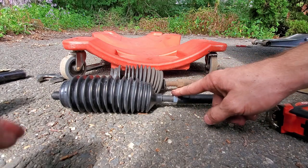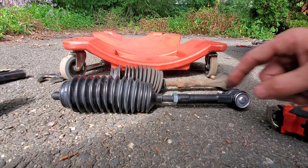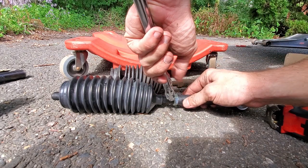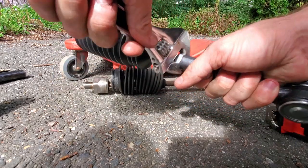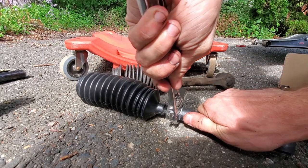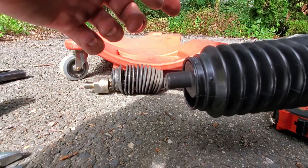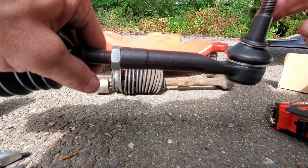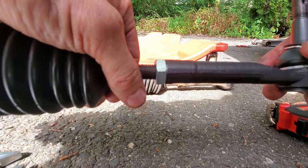There we go — all we do is lock this down. You want to make sure you lock this down because when you try to tighten this into the rack it's going to screw in, so you have to make sure you tighten this at least as snug as you can before you put anything else on. Grab your adjustable wrench and just try to lock her down. Another way I usually do it: once I start the threads from here into the rack just a little bit, I'll tighten this down again so it doesn't have a lot of play and will be locked in place into the knuckle — that gives you the leverage to tighten this down fully.